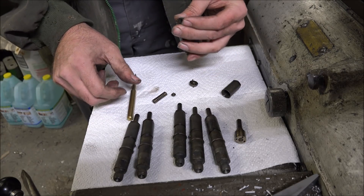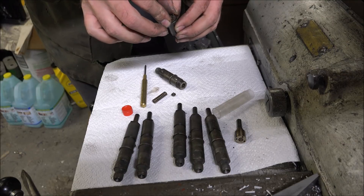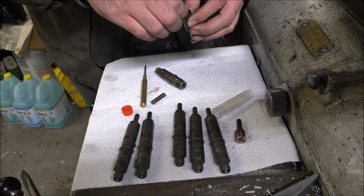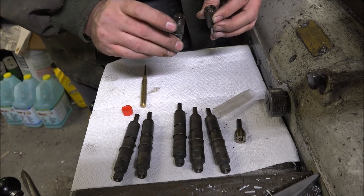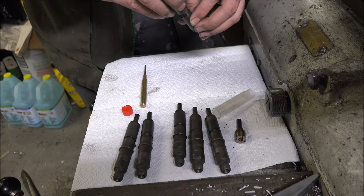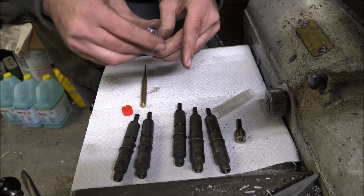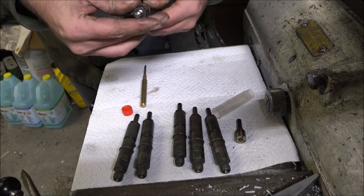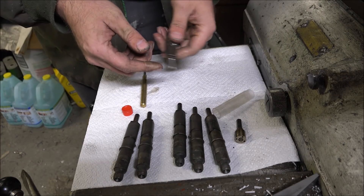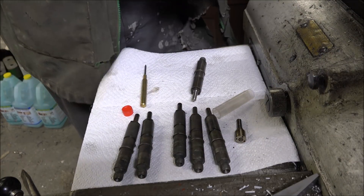Looks like no shims — so that probably isn't going to work. Plate on; make sure the hole's turned the right way. It's going to be too low to get any pop pressure without shims. Make sure the injector tip's on. I'm going to throw one of the 69s in here as a starting reference — might have to go up or down from there.